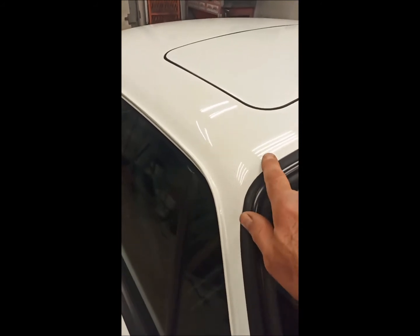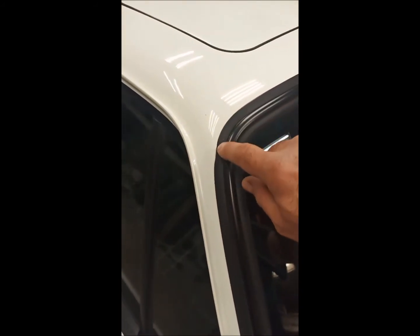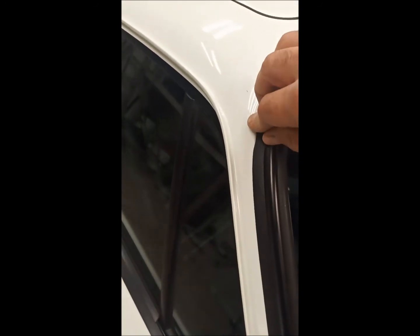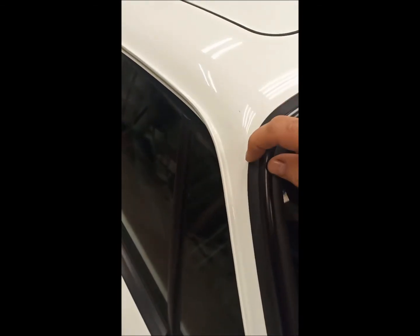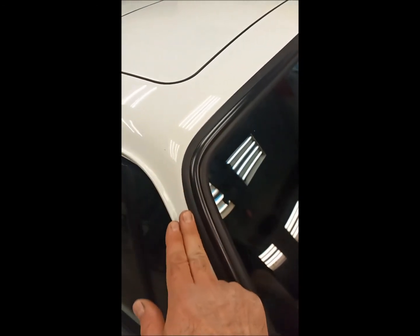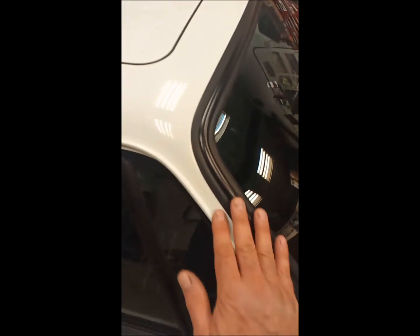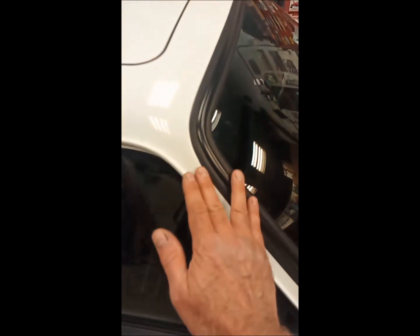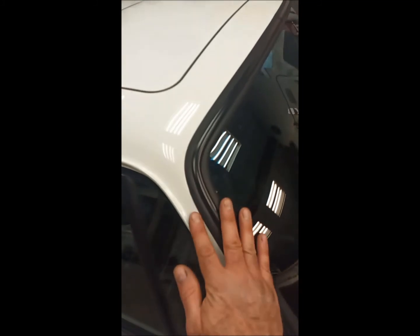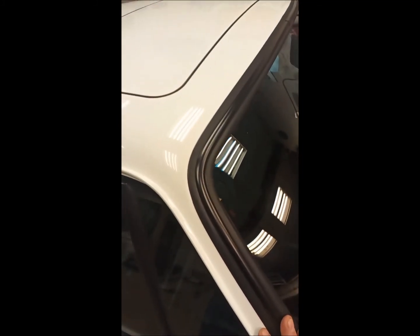This is sort of a typical issue with 911s, is that the windshield seal will actually fall into the reveal here, and if you're like me, a little OCD, you can walk along and pick it back out and get it to sit back up there. You can also push it out, and then it's good for a little while. Minor issue. Seems to be worse on this car on the passenger side than on the driver's side. All three of my 911s have the same issue. There are newer updated parts available that are just a little wider and eliminate that issue if it was to bother you.